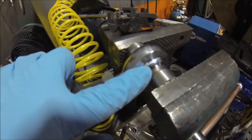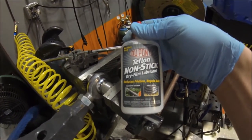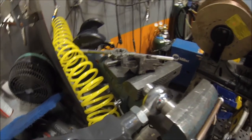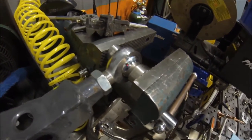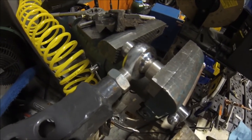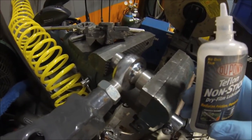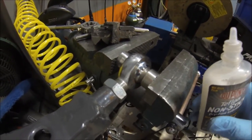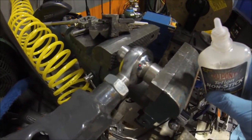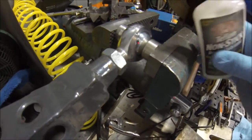What we're going to do is tip the rod end to expose the center of the ball right there, then use some liquid Teflon non-stick. I also usually suggest using the spray version — a dry lube — so it has some alcohol in it that carries the Teflon into the interface, and that re-wets the liner, which is a Teflon-Kevlar matrix. Just put a little bit there.